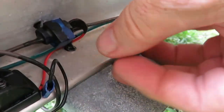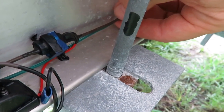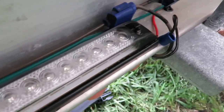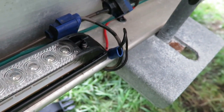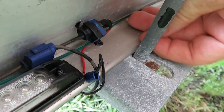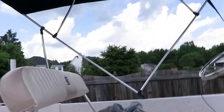I put a scotch clamp here and tied into the brown wire on my trailer — the brown is the positive. I drilled two holes right underneath to secure the actual LED light itself, and I tied the black wire into the screw at the bottom as my ground. The red goes into the scotch clamp where I tied into the power on that brown line. It's a submersible LED light, about $14 on Amazon.